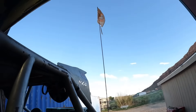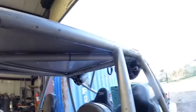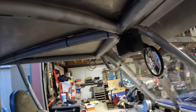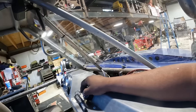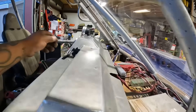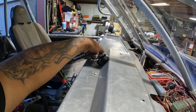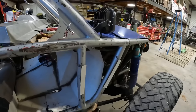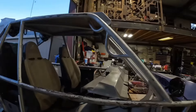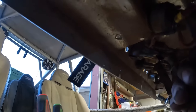It's been hard to see because it's daylight in the shop. I got it hooked up and it's working awesome - you can barely see the wires. But it won't start now. Oh yeah it will. It went to start and I was like, at least I have a stereo to kill time. Wires loose on the ignition is what I found - this yellow tab one. Look at that ignition, it's loose. Loosey-goosey.